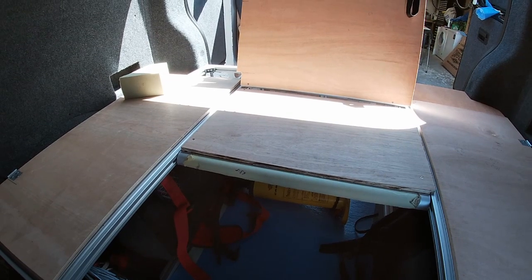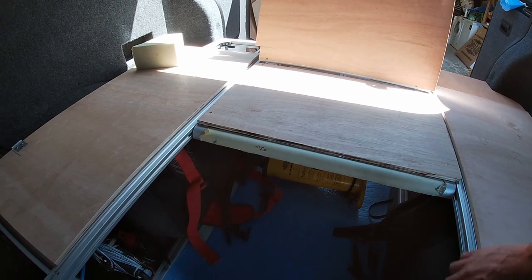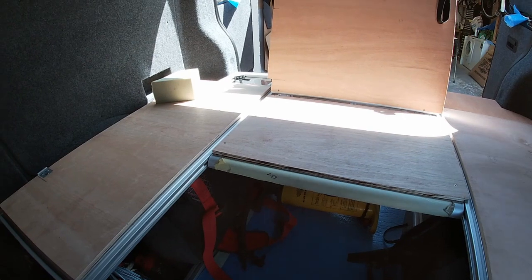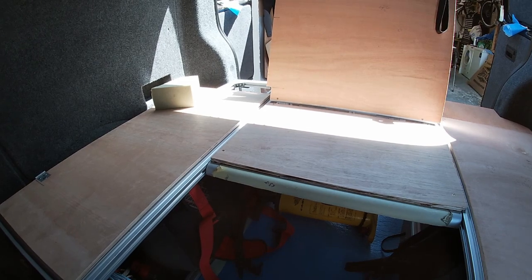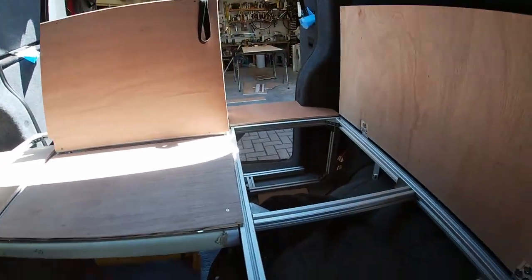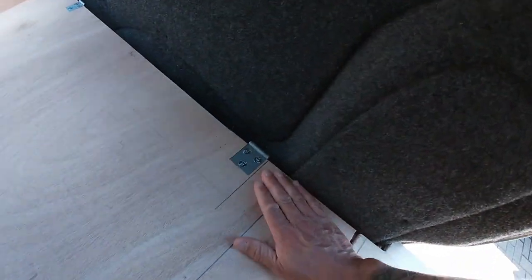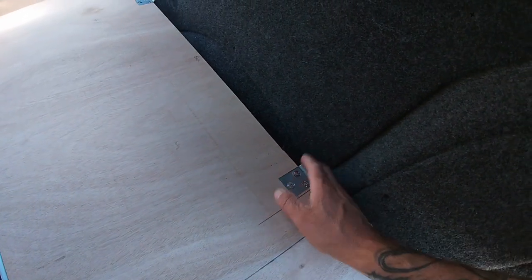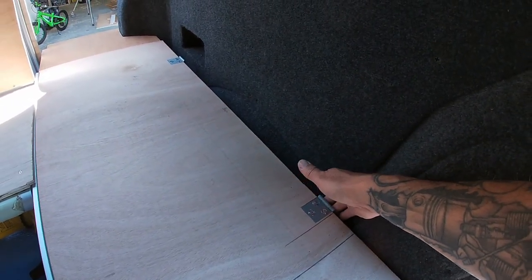So we've been working on the bed. It's on slide rails at the front here which fit into the aluminium channel, so that enables the bed to slide right forward. There are some tabs on the back which support it on the aluminium framework. Also we've been doing these side lockers — I've got both of them made now and I'm really pleased with how the routing's come out. I routed the hinges in — had to modify the back-flap hinges to fit them into the extrusion at the back, changing the position of the holes.